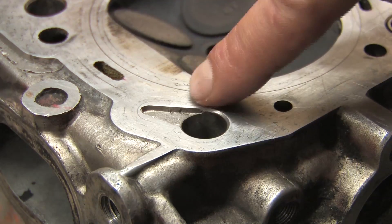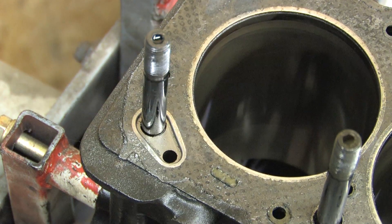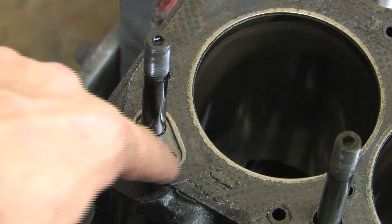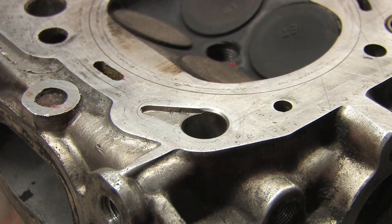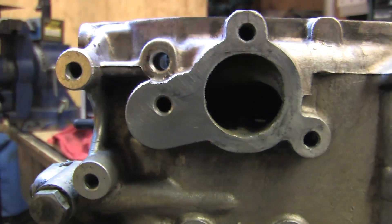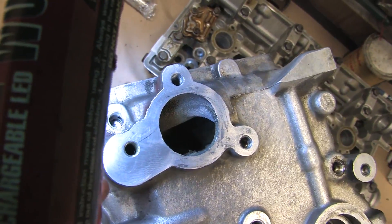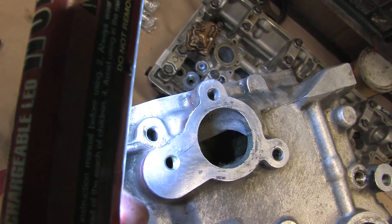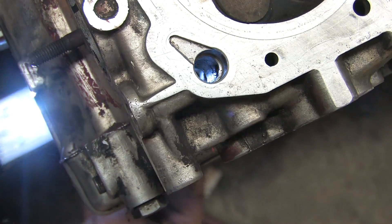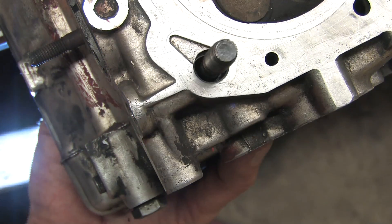This is the oil supply passage on a 4G63. The narrow end of the teardrop is where the oil supply port from the block lines up. It's sealed by the head gasket, which adds some additional thickness based on the compressed thickness of your head gasket. Oil flows through this recessed gap and up around the bolt to a hole inside the head, which intersects with the lower gallery port. That oil gallery is drilled specifically to intersect with another bore from the top that goes through the head oil pressure regulator. The regulator's job is to supply the lifters with the right amount of pressure and bleed off the excess. Without adequate oil volume flowing through this port, you'll end up with poor head oil supply and noisy lifters.